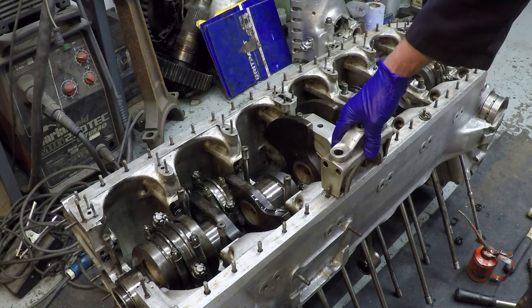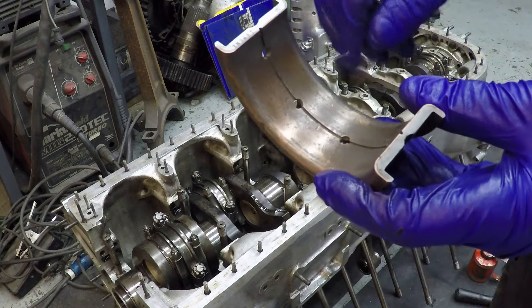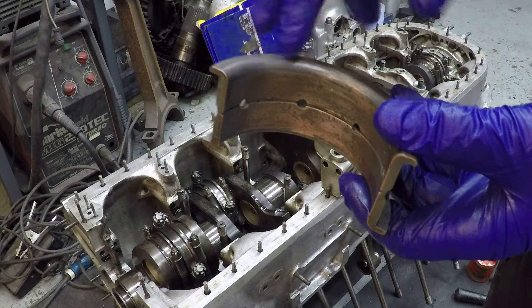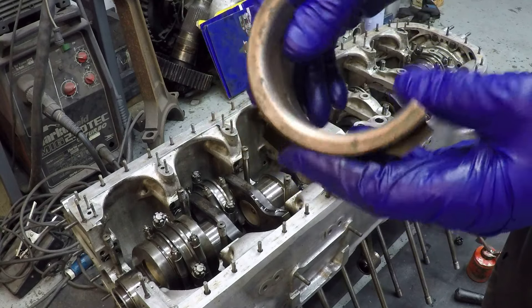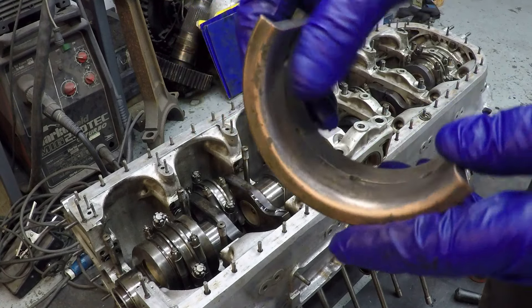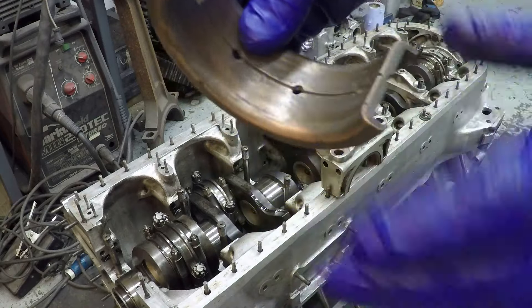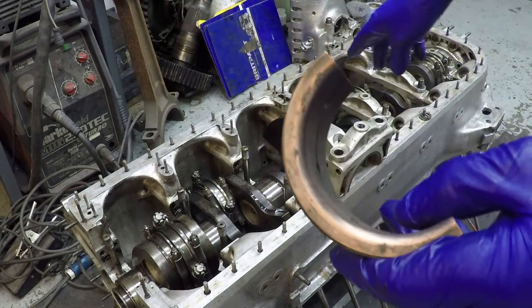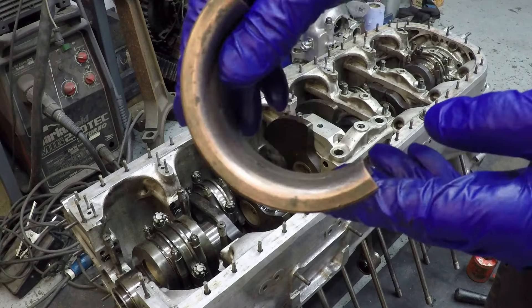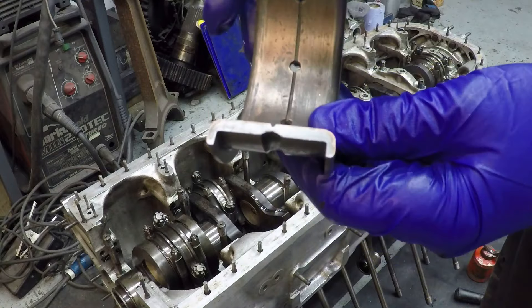Here's a spare centre main bearing shell. You can see the bronze alloy there, and they had a flashing — a very thin layer of white metal plated onto them — which wears away relatively quickly. But if an engine's done 50 or 100 hours or so, you can still see some of that material. The main bearing material is the bronze underneath. This is the number four main bearing shell, which has the thrust faces on the side of it. On a lot of modern engines these thrust bearings tend to be separate, but it's all built into one piece on this one.